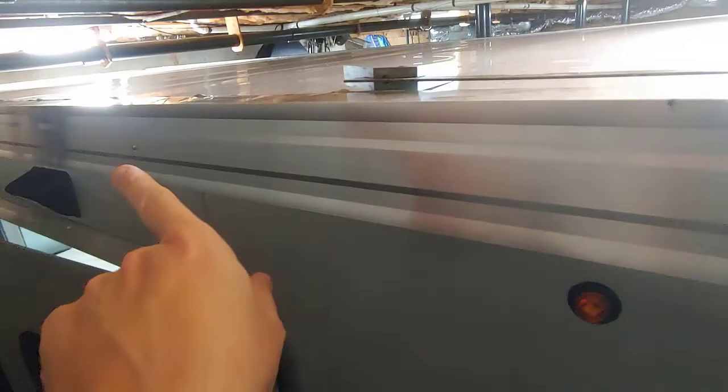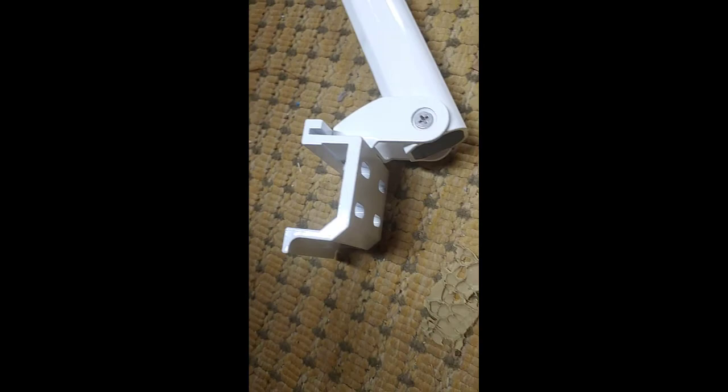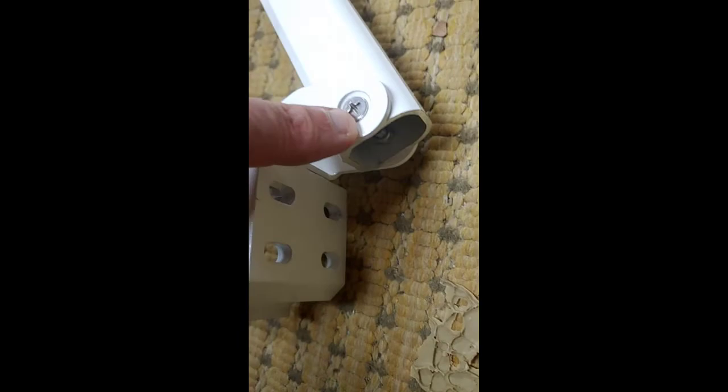And then once I get this bracket in here and mounted, and that bracket down there and mounted, they'll naturally hang and I can measure, but they'll almost mark themselves down there for the bottom brackets. I believe it's easiest to go ahead and take this bracket off. Otherwise, you're sitting there trying to mount this up there with the whole assembly. I'm going to take it off, not from that screw, because that looks like it's almost painted on, which will add to the strength. But I'm going to take these out.